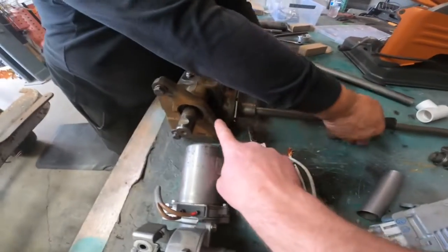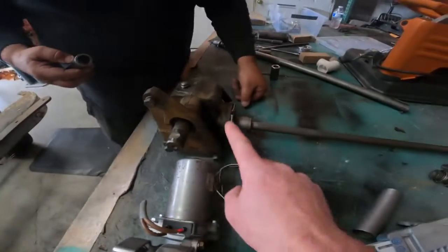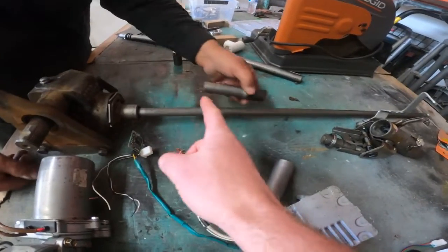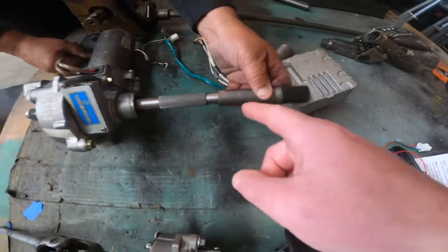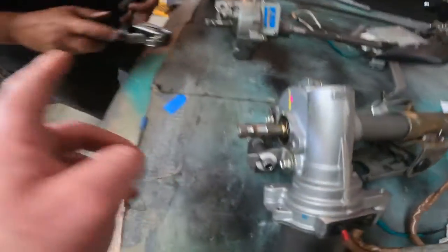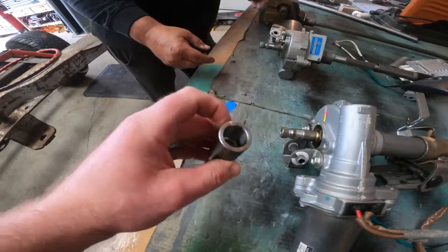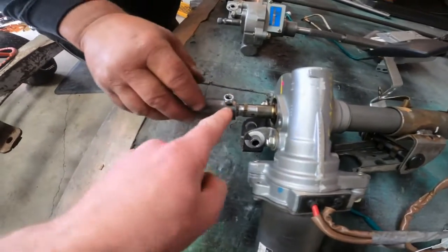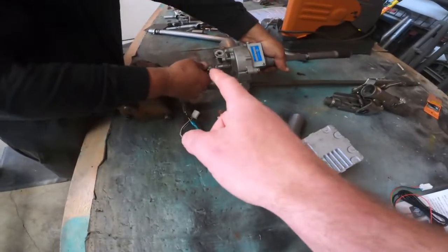What you're left with at that point is this spline shaft here, and then this piece that we cut off. You're going to cut that off and use this adapter as sort of an adjustment spline for when we're installing it into the truck. What we're looking at here is the gearbox out of one of the trucks — that's the gearbox we're going to mock up with. We're going to cut the shaft, put the spline on it from the Toyota Prius part, and mock it up. Then this here is the other end — you pull the U-joint off and they make a spline to three-quarter slip that we're going to put on here. It's a pretty tight fit but it works well. It's got an Allen key jam nut and that end will go onto the shaft.